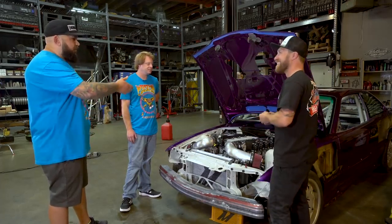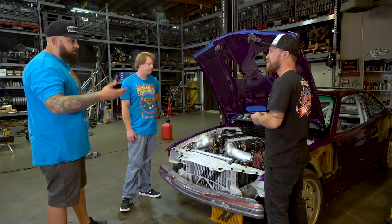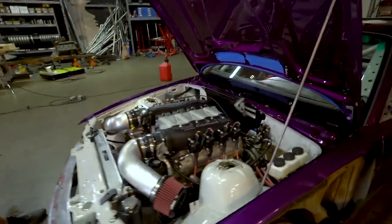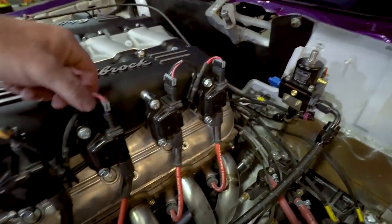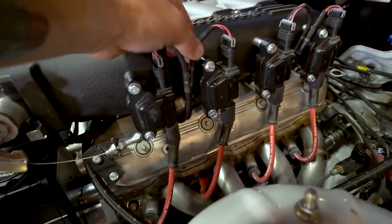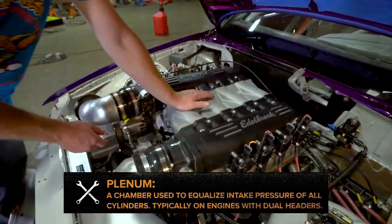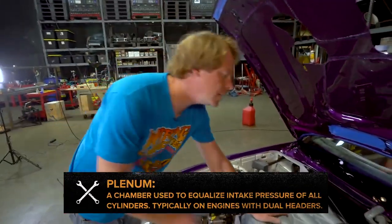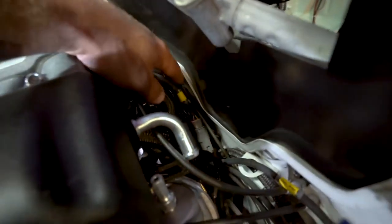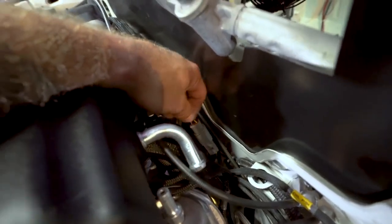You're not relying on yourself noticing you're running super lean or super rich — the ECU is going to detect it super fast and put you into a limp mode. I'm glad you guys came out and did spectacular work. I wanted a nice loop so there's no tension on the wires and everything tucks in nice. The plenum uses injectors buried underneath the center, so I put two disconnects in the back so it's modular — you can lift the plenum up without removing the engine harness. Super slick — let's get it started.